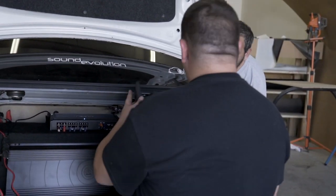But yeah, when you hook up the other coil, that's two 2-ohm coils in parallel down to 1 ohm, then the amp starts to do what it's supposed to do, and I kind of look like a jackass, but stuff happens, y'all. It's all hooked up now, and it's tuned, so I'm gonna finish this cigarette so I can stop with the shakes. See, now,